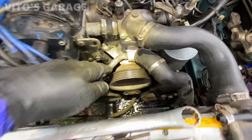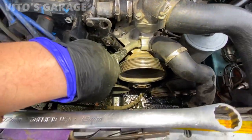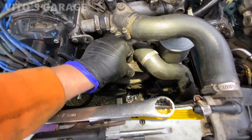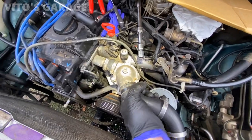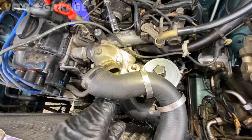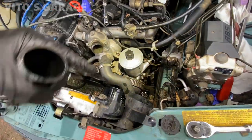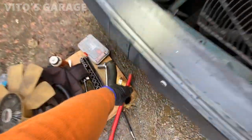Let's get to the water pump. I'm going to disconnect this line and this pulley. The water pump itself is fine, maybe it has a little bit of play, but I'm going to change it anyway. Ready to pull the upper radiator hose. On the thermostat housing — if you have a plastic one, replace it with a metal one. I'm going to clean this one up and paint it with high-heat paint. This radiator has a metal reinforcement and has probably been replaced before — really cool.